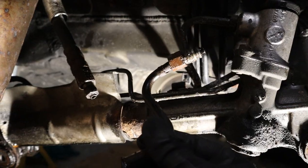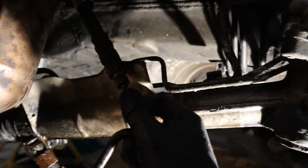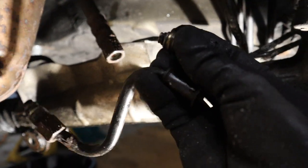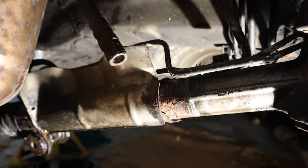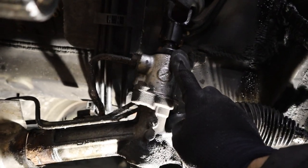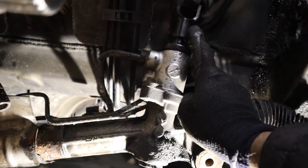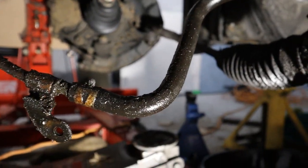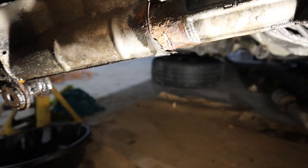Over at the rack I was able to remove the small pipe that goes into the rack and also remove it from the high pressure hose. I think I can probably just get away with replacing this piece and reuse the high pressure hose. I just need to remove this pinch bolt that holds it to the steering shaft, the tie rods on either end, as well as one return line, and then I can drop the rack down.